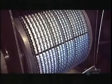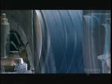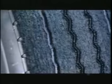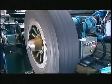There, sharp blades spinning at high speed shear off most of the worn-out rubber tread. Buffing prepares the surface so that the new rubber will adhere well and stand up to road friction. Buffing takes about six minutes per tire, and it leaves about two-and-a-half millimeters of tread on the casing.